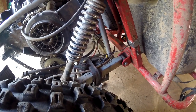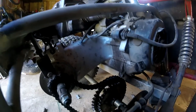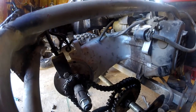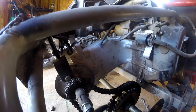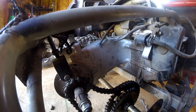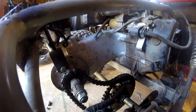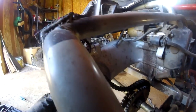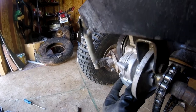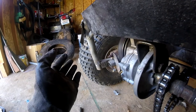I've got to find a new place to put the battery because that's just a crappy place. With how much rumbling around this cart does, just not the best place. I think I'm going to locate it to the actual main chassis. Getting the sprocket back where it was before — changing from this size back to this size — will give us a little less top speed but a little more accelerating power. You have to slide the whole thing over. While I was doing that, I was using this little bracket as a handle, which you never want to do with Chinesium because it just broke.